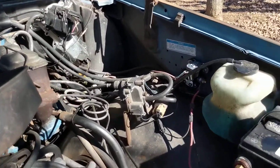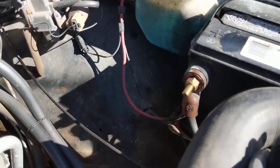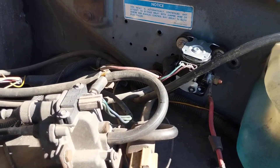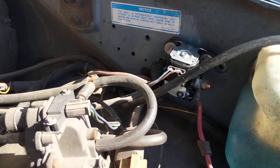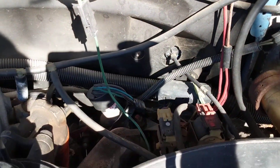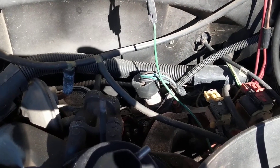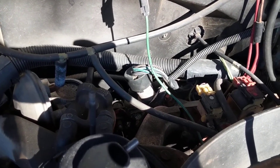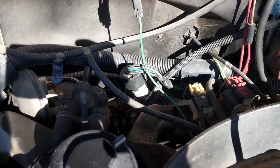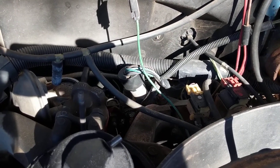This vehicle has two batteries. On the driver's side you've got a red cable coming off the battery terminal going over to a glow plug relay, and the relay connects over to the glow plug controller which is behind your air breather. That controller screws into the block, touches the coolant, senses the temperature of the engine, and tells the relay when to come on or off.